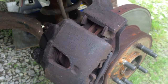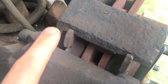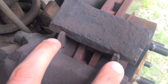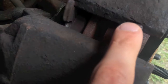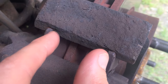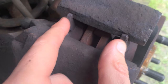One thing I want to shift focus on is these points right here — these are the brake pads. As you push the brake pedal, the piston compresses the two brake pads together, putting pressure on the brake rotor to slow you down. As you can see, it's extremely rusty. These are supposed to shift quite easily, and the more rust you have on that portion, the harder these pads are going to be shifting.